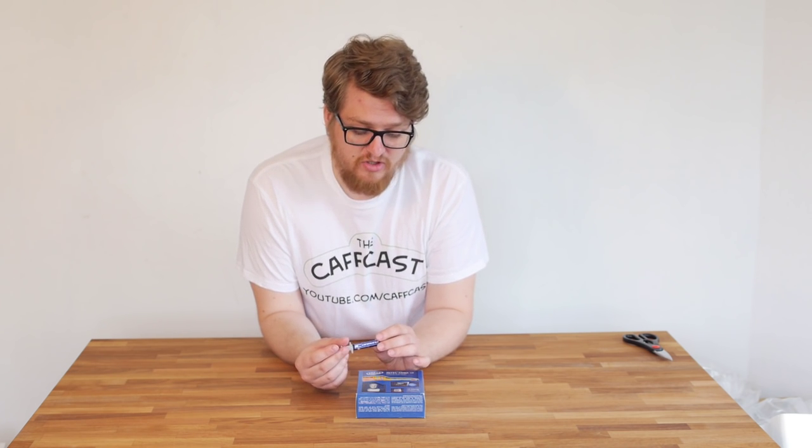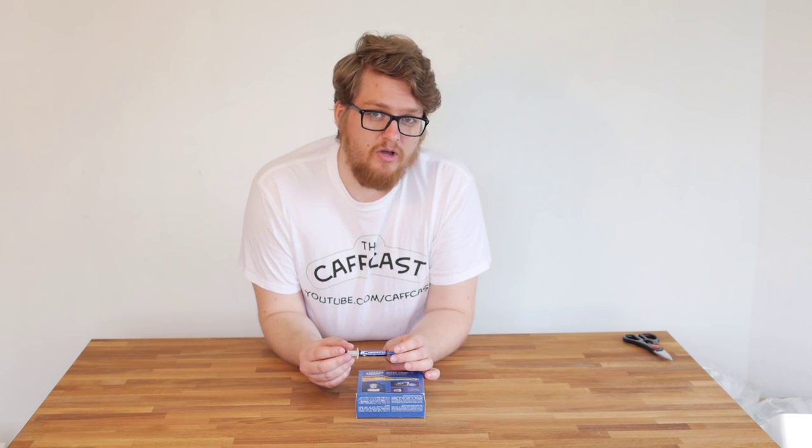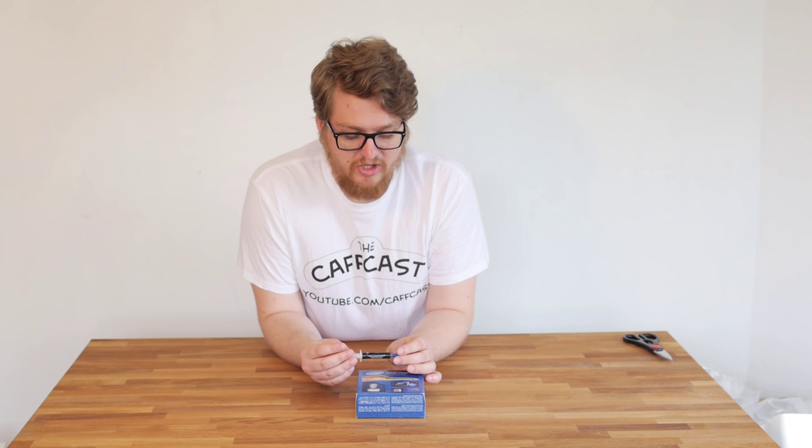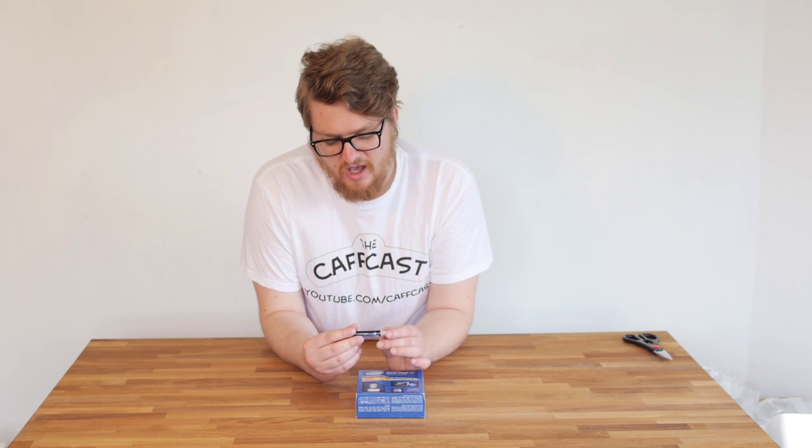But a good thermal paste can mean the difference under load. It can mean the difference between 50 degrees and 45 degrees or even 60 degrees. There's no way of knowing, but it is the thing that comes directly into contact with your processor and needs to effectively dissipate heat as quickly as possible into the heatsink that you have chosen. Personally, I have gone for the IC Diamond CPU thermal paste. There should be a link in the description for you guys to take a better look at it. But it is a 7-carat diamond thermal compound with, I think it says on here, 92%